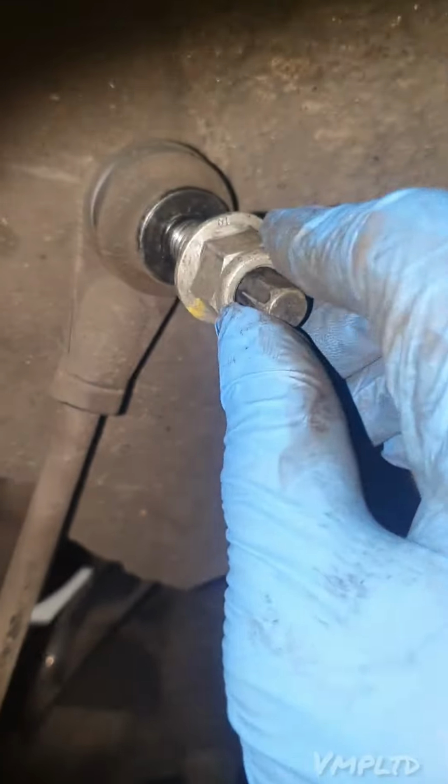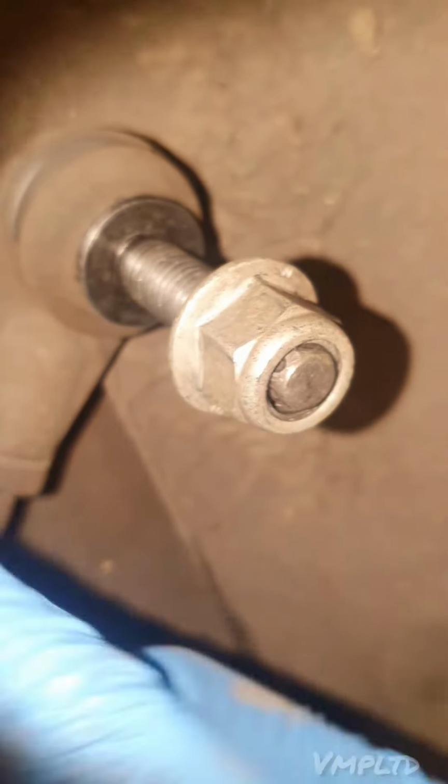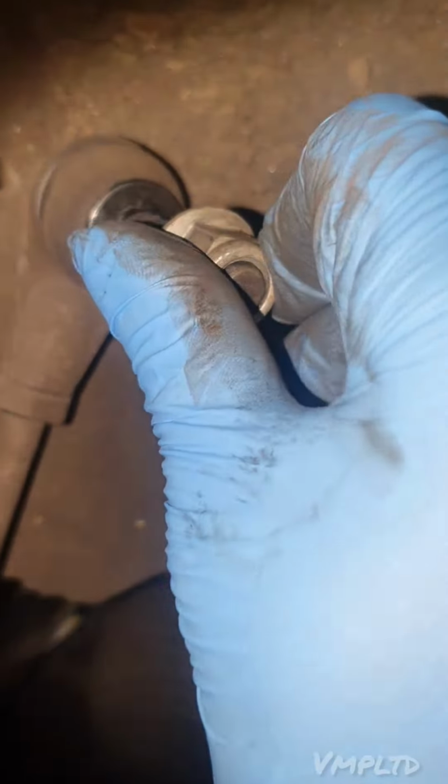Right, there are different ways to get rid of it. I've seen people with an impact wrench, on, off, on, off, on, off. Sometimes the nut will zip off quicker than the actual joint turns, and you can rip it off that way. Another advised method is cleaning the crap out of the threads. Clean it as much as you can, with maintenance spray and a wire brush and whatnot. Try to get the lines clean and smooth. Impact wrench again, zip off. These are with impact wrenches. Without an impact wrench, it's rare that you can just get the nut to run off on its own.